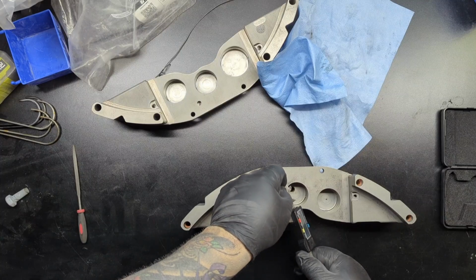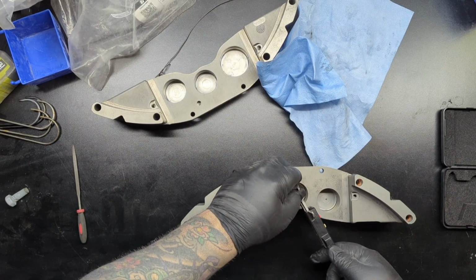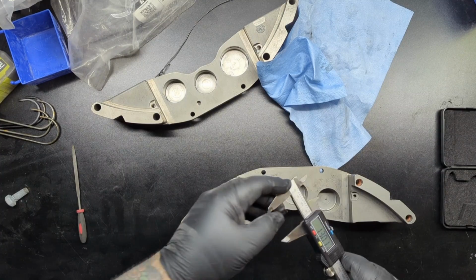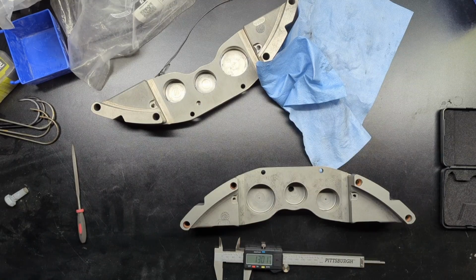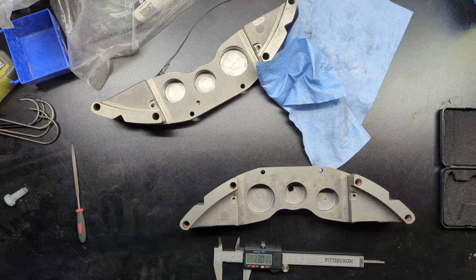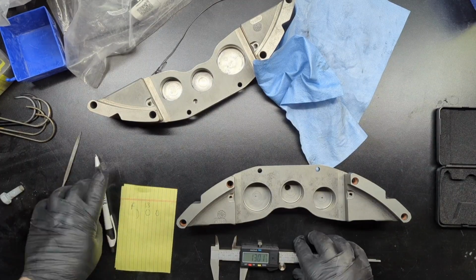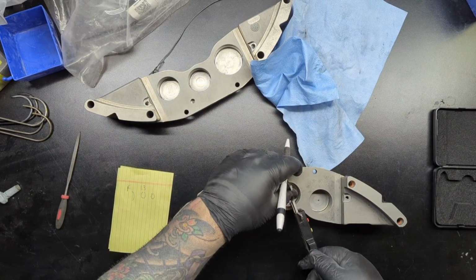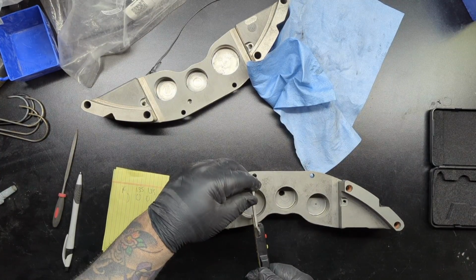So this is how I choose to do this process. I grab a micrometer or caliper, whatever you want to call it, and start taking some measurements. I actually will typically measure the factory in the way that they did it to begin with, but if I don't do that, I just measure the pistons, or I measure the piston bore rather, and then oversize it. By, you know, a 1/4 inch total, so you have an 1/8 inch on each side, or maybe sometimes I'll just do an 1/8 inch, so it's a 1/16 of an inch on each side. Kind of depends on the caliper.